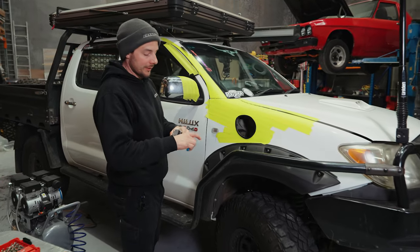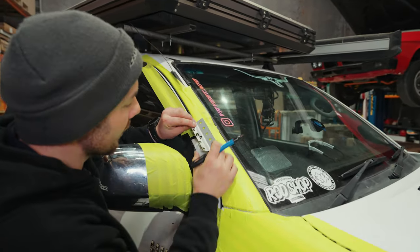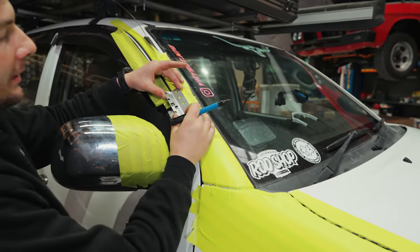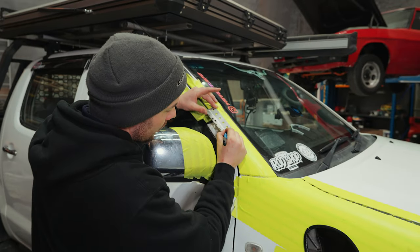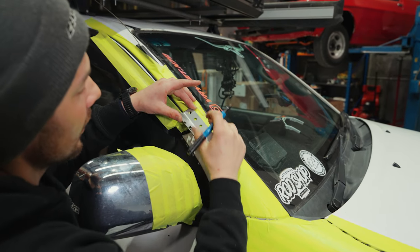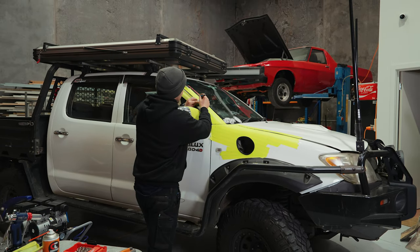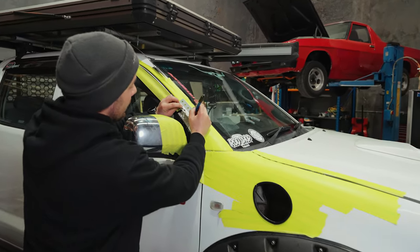All right, so I'll show what we've done without the snorkel, because I actually need the cameraman to help me hold it. And it was a bit hard to film in there anyway. But what you do is just put two of your bolts into your snorkel. You're going to have your snorkel in and place it up against here. This will just sit where it needs to sit. And then you're just going to draw a line for the bottom, a line for the top, then just mark the center of your hole. We're going to do the one hole first. Place our rivet in there. And then we're going to mark this bottom one as well and make sure it lines up with that line. And then we're going to drill this one.